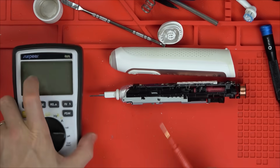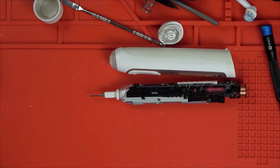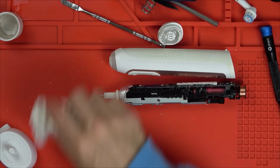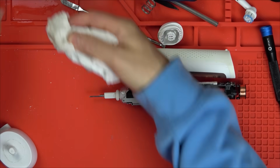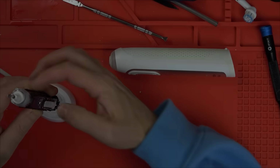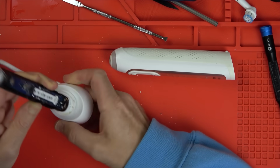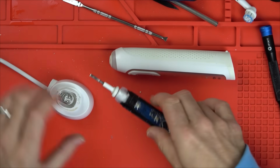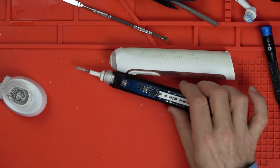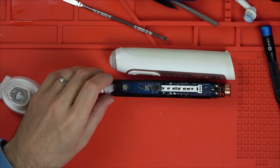Right, let me put it on the charger in case it needs to go back on the charger for some reason. Maybe it's kind of reset itself. I brought it down, I just spilt my IPA. Do you know, I haven't done that in a while. No. It's completely dead. How bizarre. I mean, I'm tempted to short the PP fuse out, but I've got voltage on both sides of it.